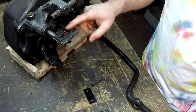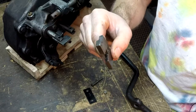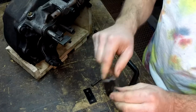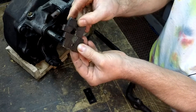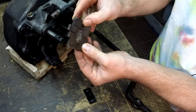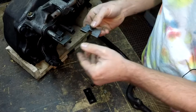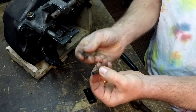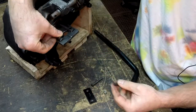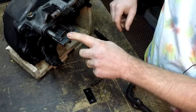The way this goes together is these plates fit into the shifter forks, and these shifter forks are not modified. These are just quarter-inch plates that I've modified with this profile on them. You can see they're going to slide past each other like this, so you assemble them and put them in here. These are the stock pins that hold them in place.